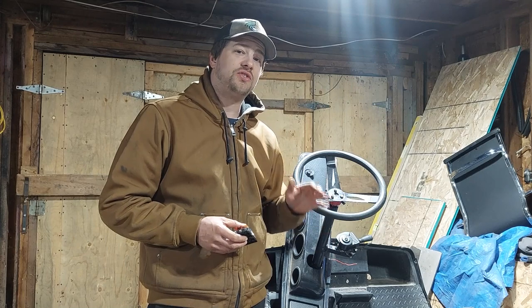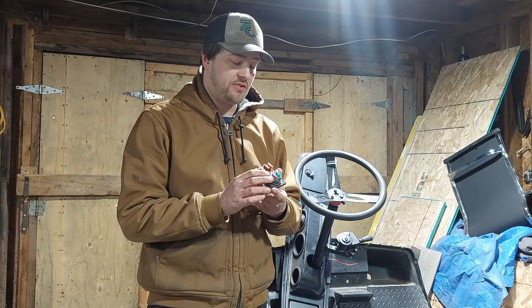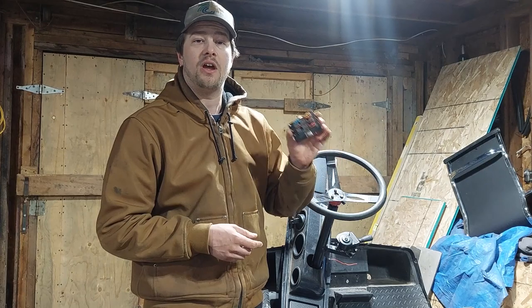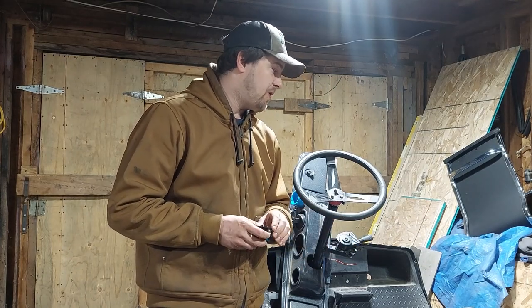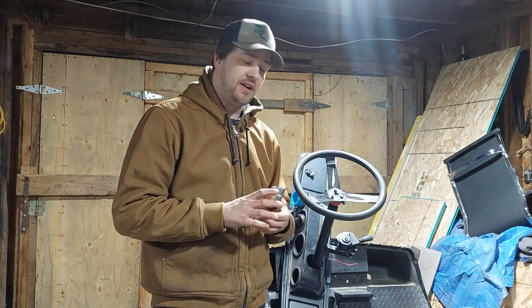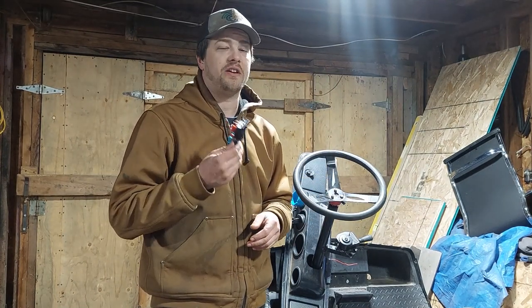The cart was set up, it actually didn't have any sort of electrical protection. So I'm going to throw in one of these 6-point fuse panels. These are wicked little blocks here. They got a series of LEDs. They'll tell you exactly which fuse is blown. Makes it way easier, much safer than the way it's sitting now, because I'm not going to lie, it was pretty close to burning down on the side of the road. So we're just going to throw one of these in, and it's going to get rid of all the problems that we had. Just clean up the wiring way better and make things a lot safer.